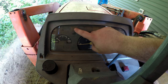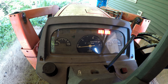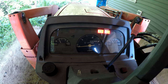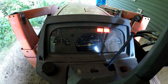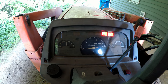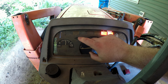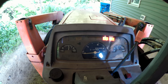Normally this light here — this is the glow plug light — you would turn your key to the first position and it goes out. I'm not a diesel expert by any means; this is the only diesel I've ever owned. My understanding is that this light indicates warming up the glow plugs. Sometimes this light either doesn't come on, or it comes on and stays on and doesn't go off, or while I'm driving it, it flashes. There's definitely something wrong. It has not always done this — it's just done it recently.